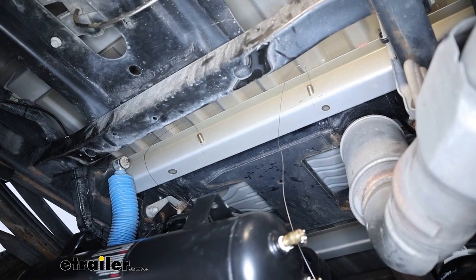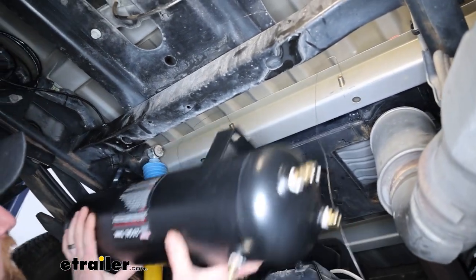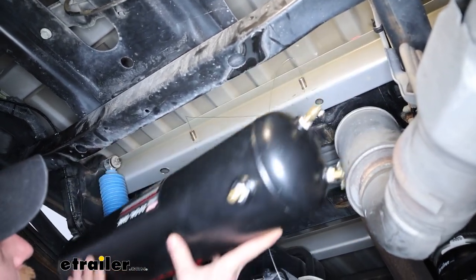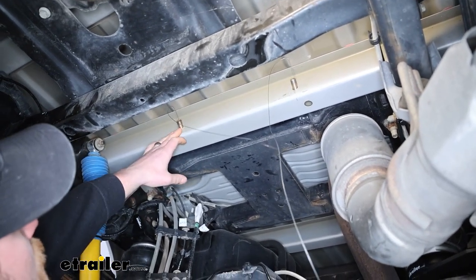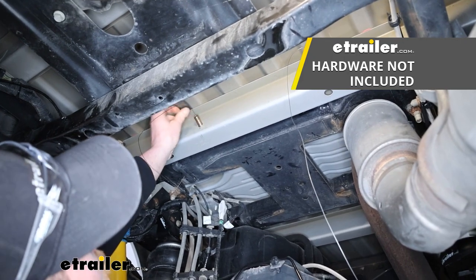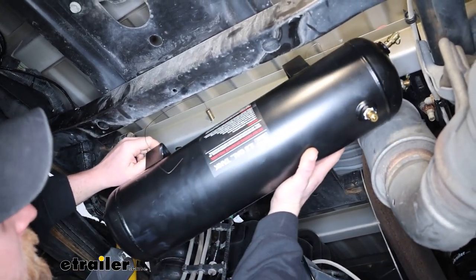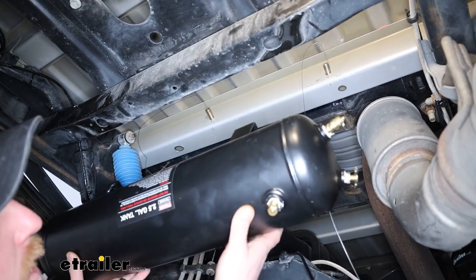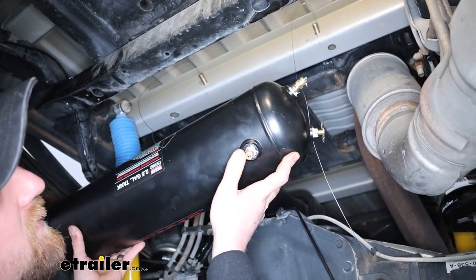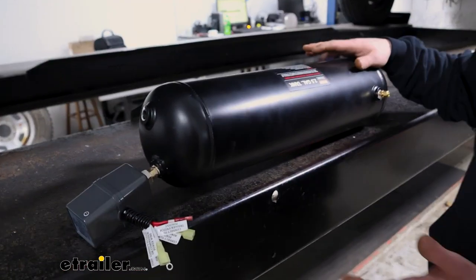What I ended up doing is using our hat channel — we're going to use that as a mounting point for brackets that are going to have some holes in them, so the tank will sit up there like this eventually. I just held it up, lined up where I want it to go, and drilled two half-inch holes. Then I used a carriage bolt, a spacer block behind there, and some fish wire to get the bolts up through. That way we can run these through and put a nut on our bracket to actually bolt this up. Before we do that, you want to eyeball everything, make sure we have clearance, and find the best spot for our fittings, and get those in place first.